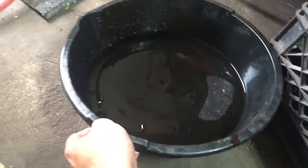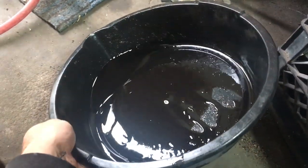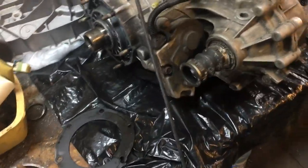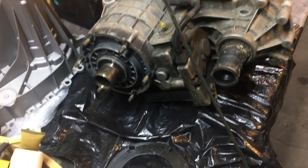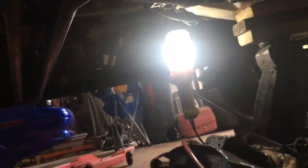I got the case out. The bolts are 15 millimeters and I took them all out. On my last truck — the Duramax with the ZF6 manual — the crossmember was placed more forward and I could pull the transfer case without dropping it. That wasn't the case with this truck; I had to drop the crossmember. A little more work, but it's fine.